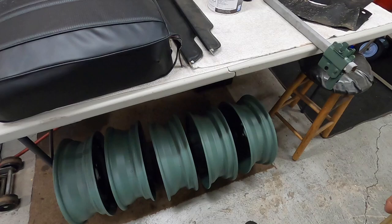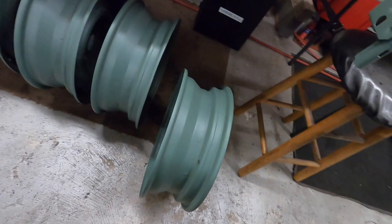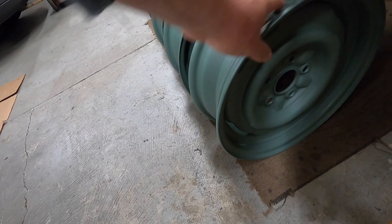So they look fine. And some wheels, you know, on the 50s cars and stuff were body color. So from doing all these cars over the years, the ones where this part was painted body color, the wheels were painted black first, because a lot of them, the back of the wheel will be black, this will be black, and this will be body color. And I've done it on original wheels like that. So they just spray the body color over it and let the overspray blow through the backside. That's why the factory did them originally.